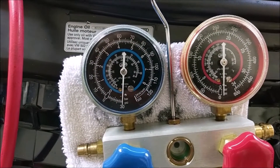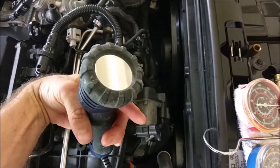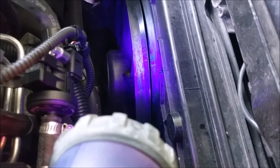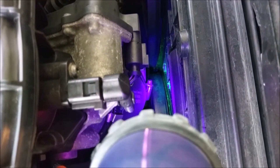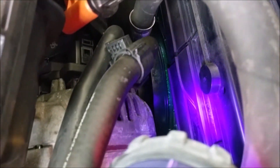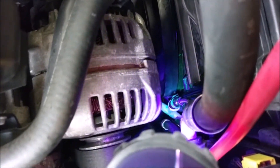30 inches. So we're pretty close to being ready to charge. We're going to use our black light here, and you can see when the sensor blew, the dye and oil is everywhere. So we lost a lot of oil because it was more of an abrupt rupture — it didn't leak out slowly. It blew and went everywhere.